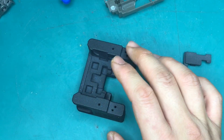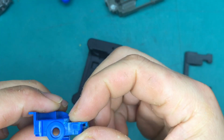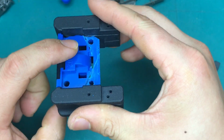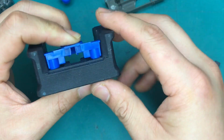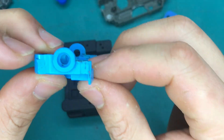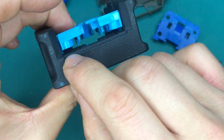And the second step is to do this first. Okay, if you want to cut the front bumper and make the bumper lower, this is what you have to do first. The reason, which I can show you right here, is that when you install it, put it on top and start cutting, you can see back over here there are two bolts touching the tool, and even though you're holding it, it won't move. But if you do the other step first, for example, like this, see here it's already cut, so here is higher, here is lower, so when you put it on all the way down, you can realize at the back there's a big gap.